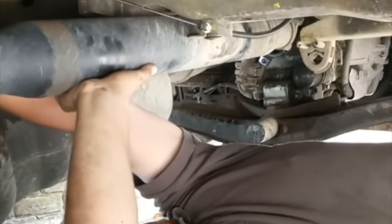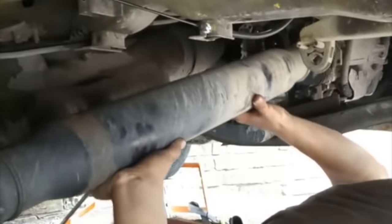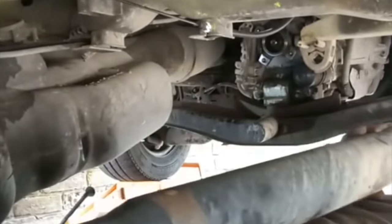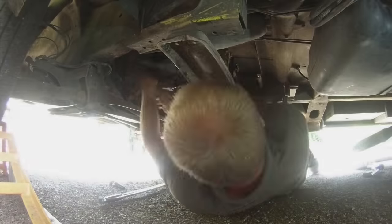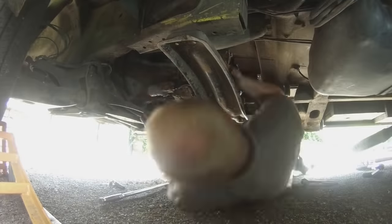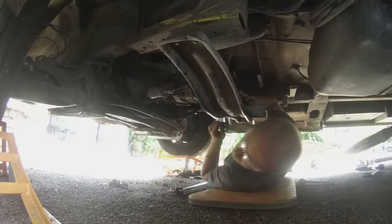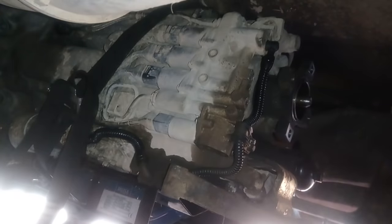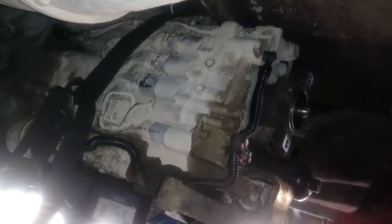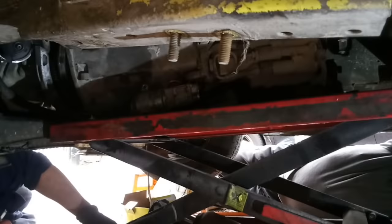It's going snakey! Next up was taking all the bolts out of the bell housing cross member — not very interesting, so I've sped it up. With a lot of faffing about they eventually came out, but to get the last two out I had to drop the gearbox. Now I can get to the top bolts.